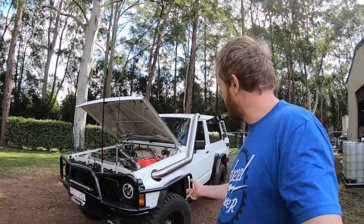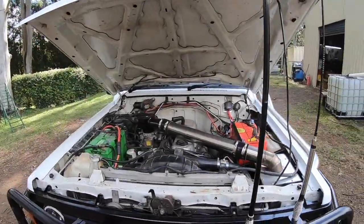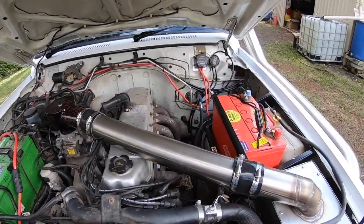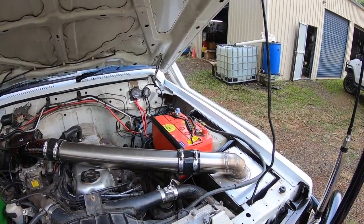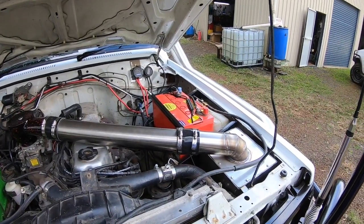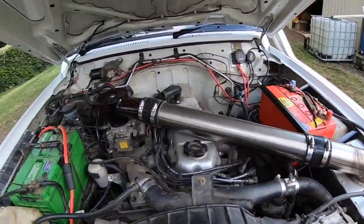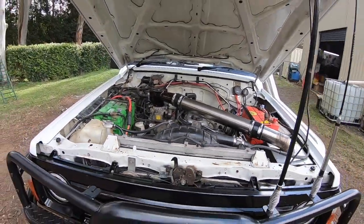So you've seen the storyline, that'll give you a rundown. Under the bonnet, she's a good old TB42 Carby. Nothing too fancy, just a set of extractors on it. Dual battery — the dual battery box is ARB, meant for a 4.2 or TD diesel, so it relocates it in the middle. Custom stainless airbox that I made going to the carby, and an alloy radiator.